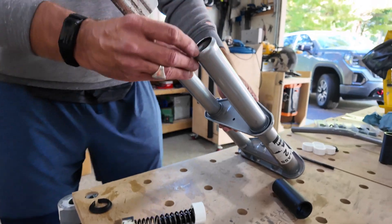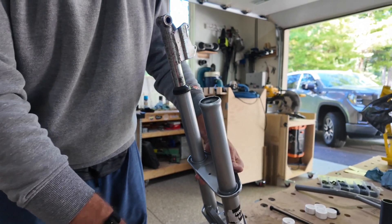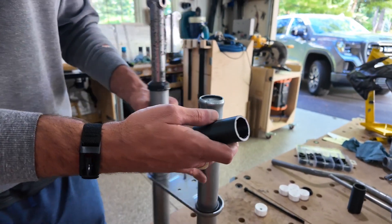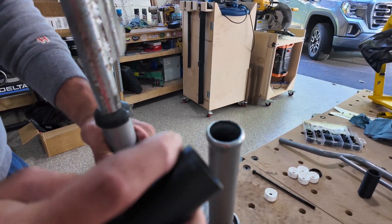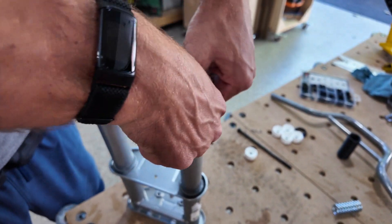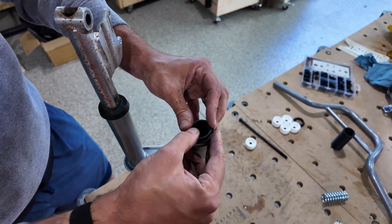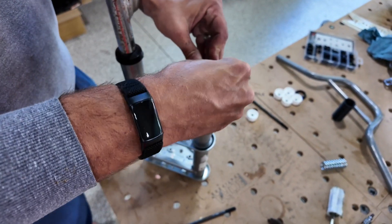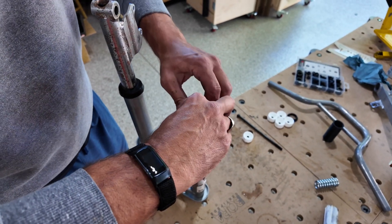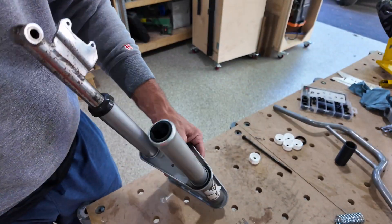We'll work on putting together the lower piece by inserting our new bolt into it. Starting with the larger spring first — it pretty much stabilizes itself — then the bushing piece, then the original factory spring, then the additional 3D printed bushing. Note that these 3D printed bushings have little nibs on the top that go towards the top. Push this down inside — sometimes it takes a little force but this one's not too bad. Then place the retaining clips, snapping them in one side at a time. If they break it's not a big deal — you can always 3D print another one.